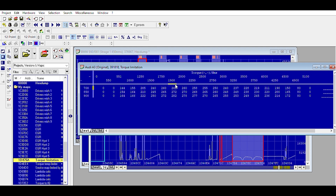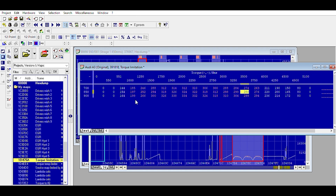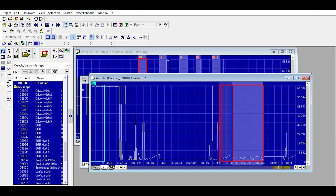It's not big but it is a decent drop. Depending on the torque IQ maps, this could dictate at least five milligrams of fuel drop — which could be five or six PSI drop — and that could make the difference between blowing your turbo and not blowing your turbo. So you cannot just increase everything carelessly. If you did a flat 20% increase, you can see the difference stays the same because we're increasing everything by 20 percent.